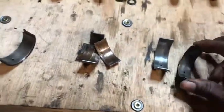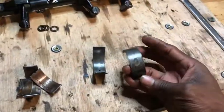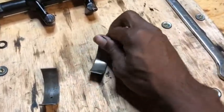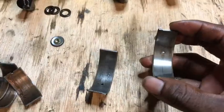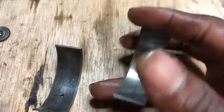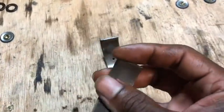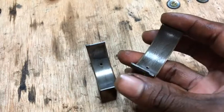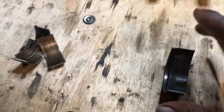I also pulled the other bearings and did all the crank bearings on the car. Cylinder one is totally fine, pretty good. What I do notice is there's some wear on it — you can see the impact points and it's nice and even, but it's not that smooth, it has a little groove to it. On the crankshaft itself it's perfectly smooth. I don't understand the chemistry behind why that's happening, but these look shot while the crankshaft is perfectly smooth.